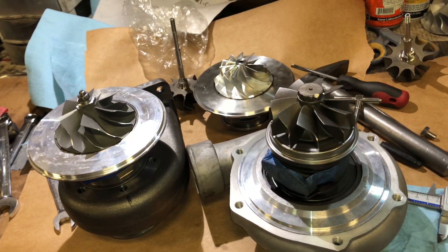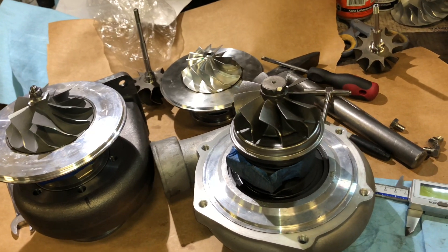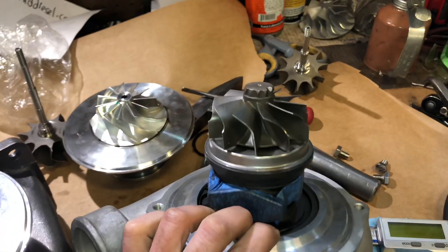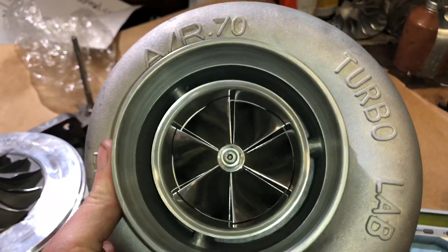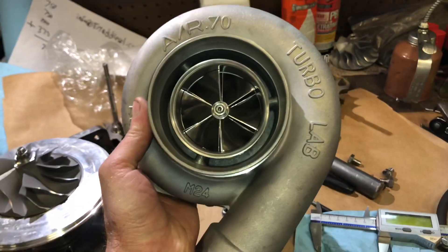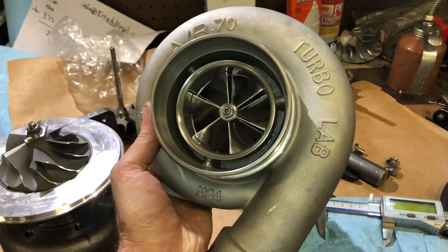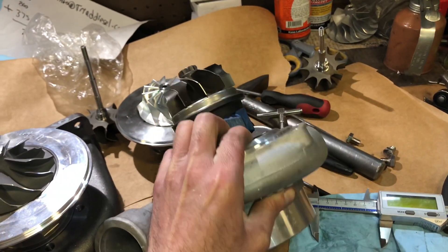That brings it over 950 horsepower rather than a limit of 600. Those are the only two options I have on fixing this VS Racing turbo, or you could just leave it alone and run it that way. I think it would be pretty decently reliable because of the thrust bearing design — it's a very updated design. This is a compressor housing that we have for these cartridges too.